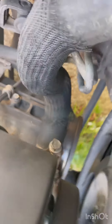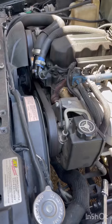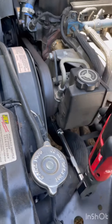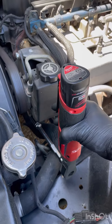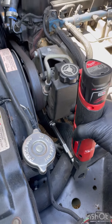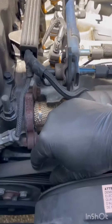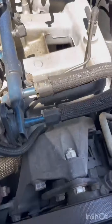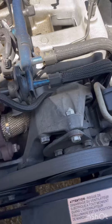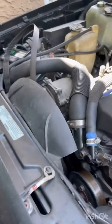Once the bolts are loose, you can then hit the tensioner bolt right here. Luckily I don't have my air box anymore, so it's easy to access. With the tensioner all the way down, you can see lots of play in the belt, which allows you to swivel the steering component down to loosen things up and take the belt out of the way.